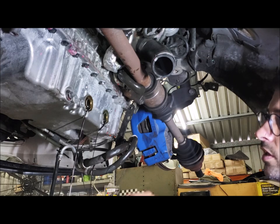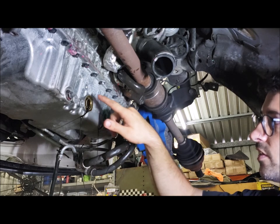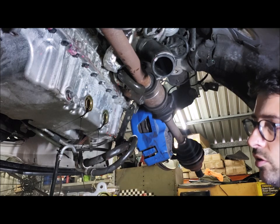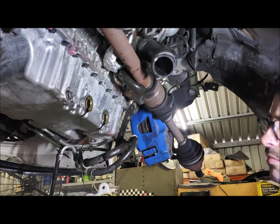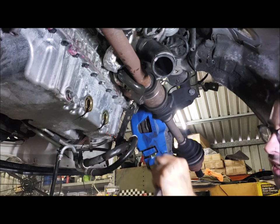You're going to get just a small amount of oil. If you look in these recesses, that's where the O-rings sit — they either end up staying on the sump or, in this case, they're both on the back of the oil cooler. If you've purchased an oil cooler with replacement O-rings, you can just throw these away. If you're reusing them, just pull them off.